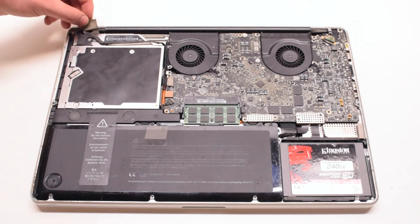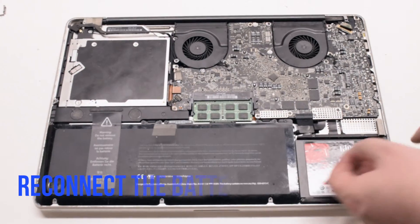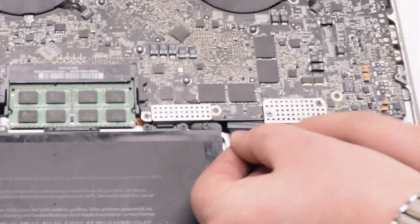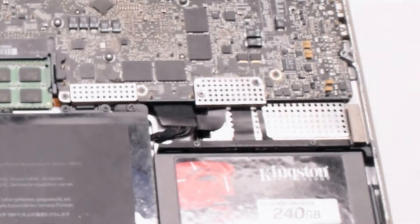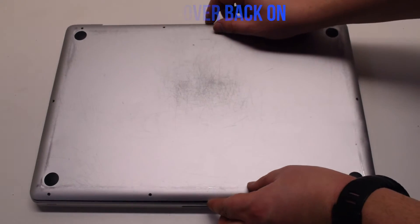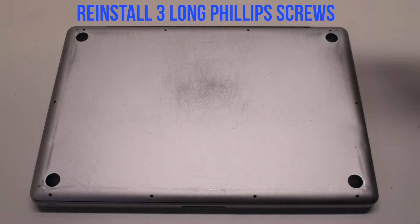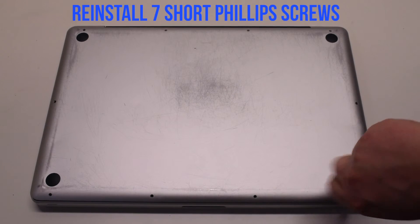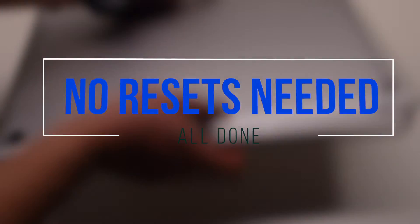One over the EyeSight cable bracket portion. You can now reconnect the battery — gently slide it into the socket. Look down and get a better angle, as you need to make sure that this goes in correctly. Place the cover back on. Reinstall the three long Phillips head screws first, then reinstall the seven short Phillips head screws. No resets are needed. You're all done.